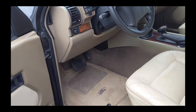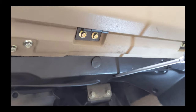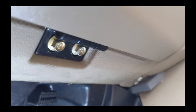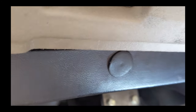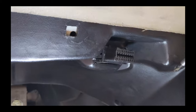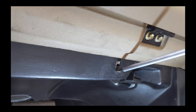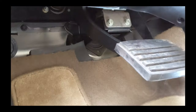The first step to working on the brake lights and getting access to the switch is removing this panel. Under the dash you're going to have this black panel. Mine had a plastic screw — it's not even a screw, it's like a plastic rivet, it just pops out. Gently remove the OBD2 port; it will pop out and go through the back. Don't just rip the panel off with that port mounted because you could rip the port.